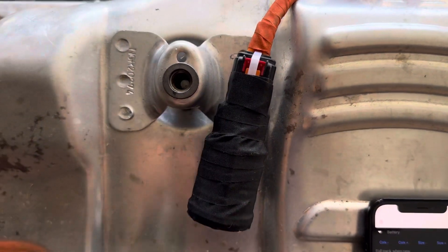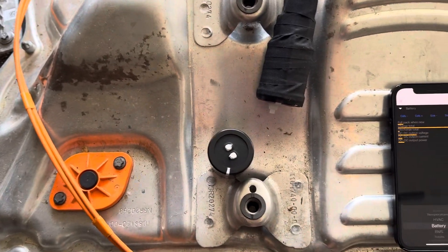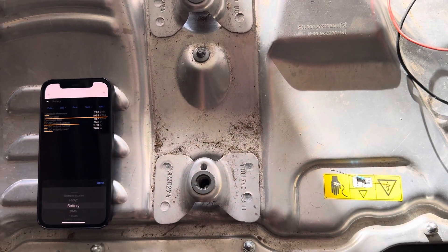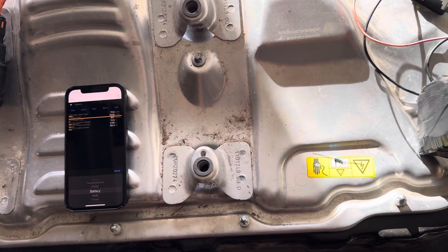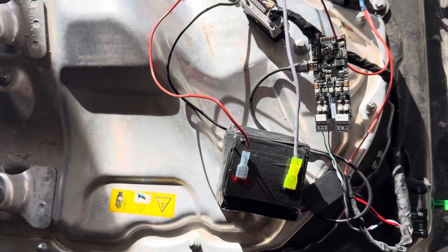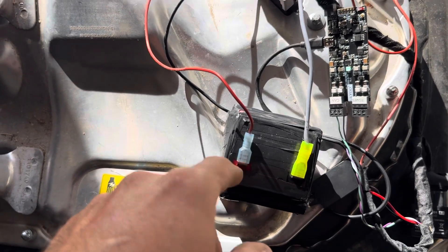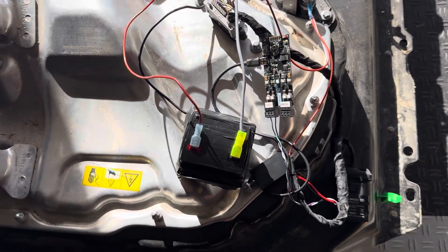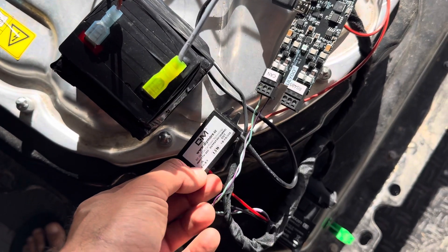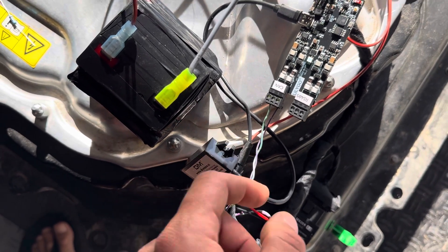Other people also open up the penthouse lid and wire the capacitor inside to plus and minus. But I want to have the lid always be closed and I don't want to mess with what's inside the lid — I want to just connect everything from the outside. This battery is only used to start the process when the contactors are open. Once the contactors are closed you can actually disconnect any battery and it will just run on its own. I use a little DC-DC step-down converter to power this LUIGO board — it outputs five volts to the board.